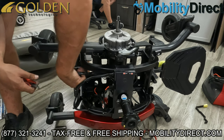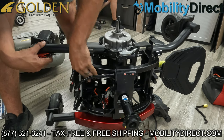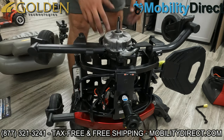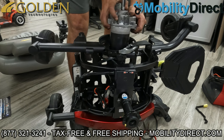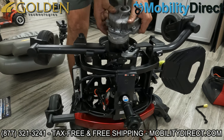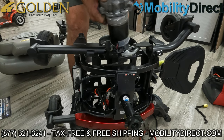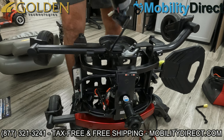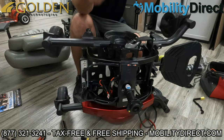It's got a very small clearance, and you will need to disconnect the motor main wire harness, which is zip tied to the frame. I removed the two zip ties, and now that everything is disconnected, you can see that the motor is sliding out. You do have to shimmy it out a little bit, and that suspension plate needs to be completely up as far as it goes so you can clear that little hole that the motor slides right through.